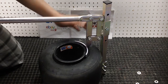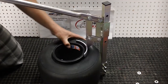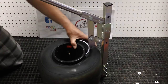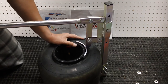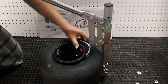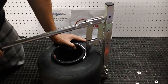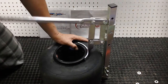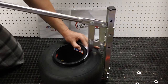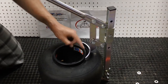So we have the height set and we're going to slowly break it down. Now I'm cheating on this one — it's not fully beaded because I ran out of air in the air compressor to fully bead it. So they're seated but it's not fully set up. You can hear the air leak out. And again, as you're doing this, you want to make sure your tool is not digging into the rim itself.